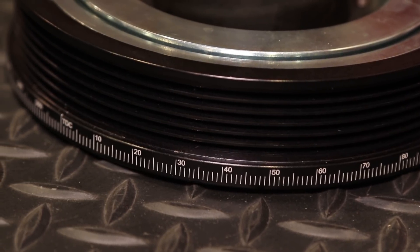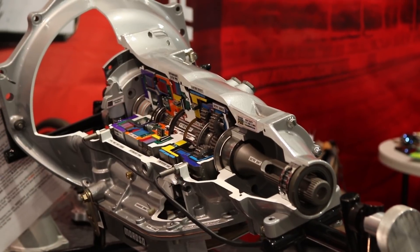So I know that some products have a little bit of technical difficulty for the user as far as bolting it on to the car. Is there any modification that needs to be done for this product? Sure, so the race version is a little harder to bolt on because you have to pick up the timing belt and the keyway at the same time. With both dampers you're going to need a sander — there's a dust cover on the front of the engine with a rib that's in the way. You can knock that out of the way, and for the timing belt there's one spot you drill a half inch hole so you can get into the adjuster without taking the cover off. Other than that it's a really easy install.